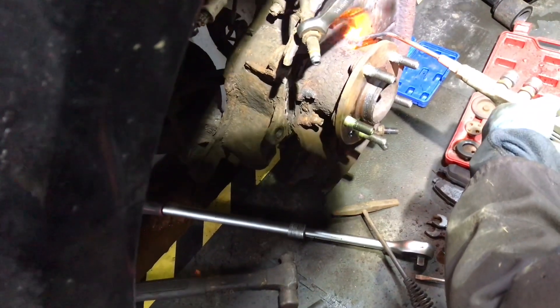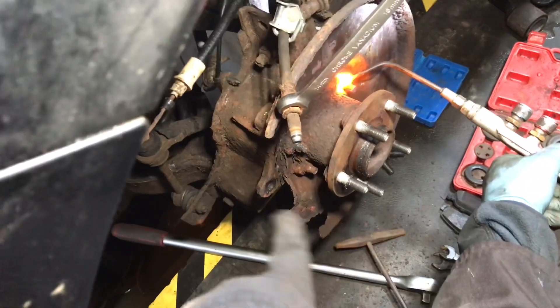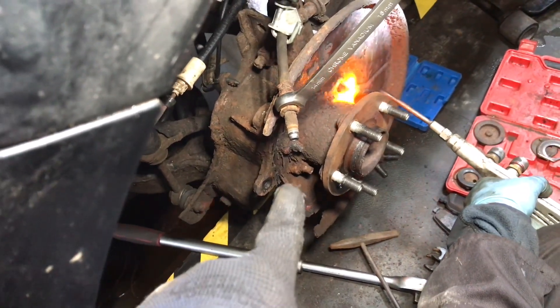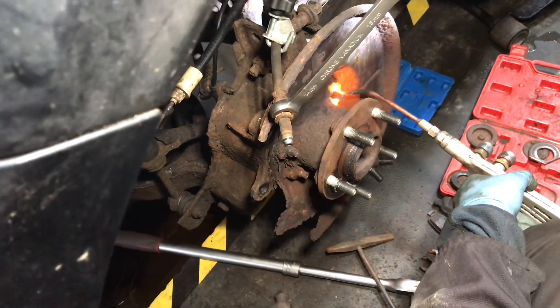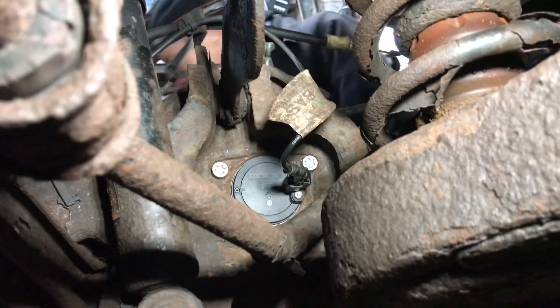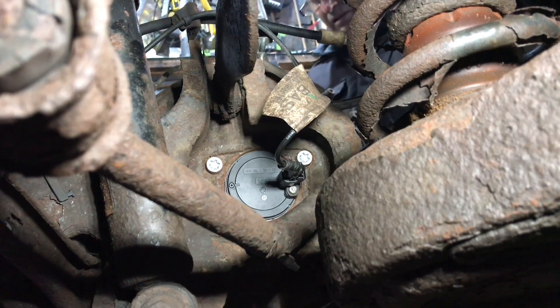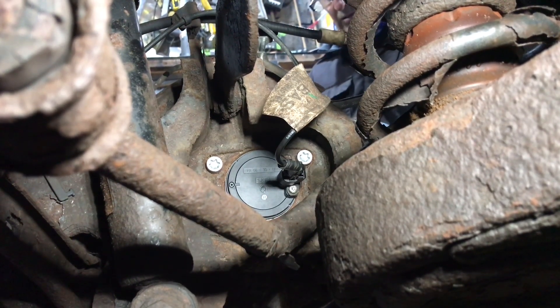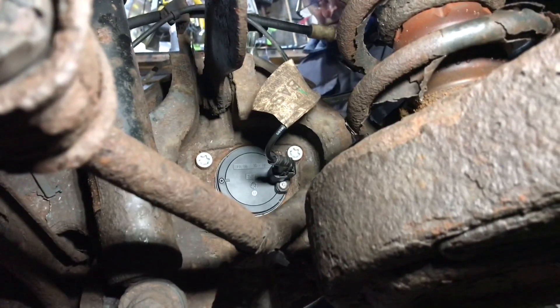Back to the Mondeo. We're doing the rear caliper and the wheel bearing. Best to strip everything down before you take the wheel bearing off, because these nuts go right through to the other side and it's a T55 Torx — you can get them halfway out and then they just stop, so clean them up then continue. The access to the bolts from the back is quite poor. New bolts go back in because you get new bolts with the kit. Always remember to put your ABS sensor back on.